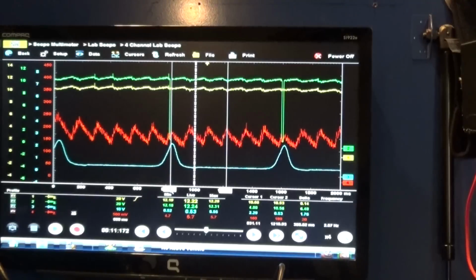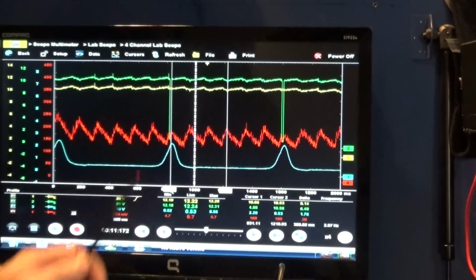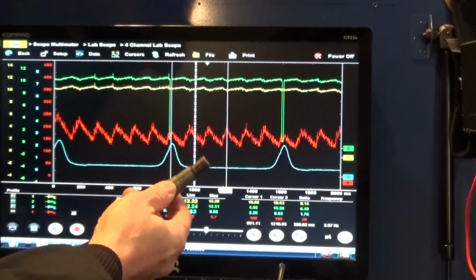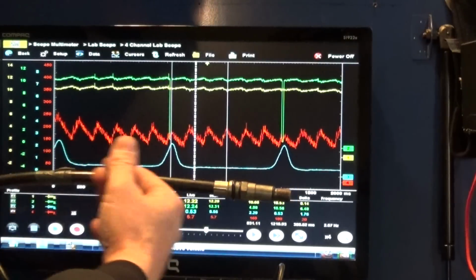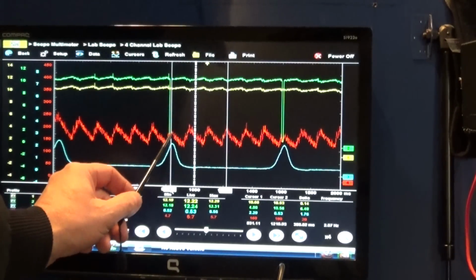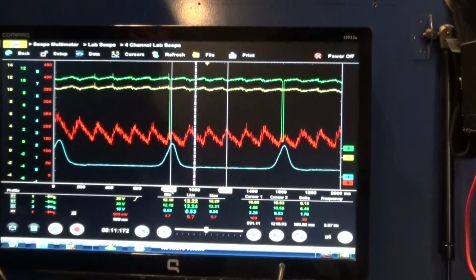Simply, as I said in the beginning of the video, since I had my in-cylinder pressure transducer adapted to my cylinder, and I took my Schrader valve out of it, the air that's pushed inside the cylinder is pushed into this hose as well. So the same amount of air that is sucked in is not compressed against the same volume. It's compressed into the volume of the cylinder plus the volume of our hose. So that's why we see less, our amperage is actually less, because the compression is less in that cylinder.